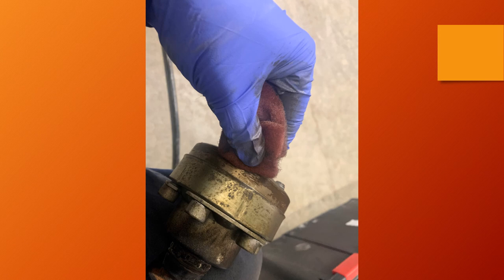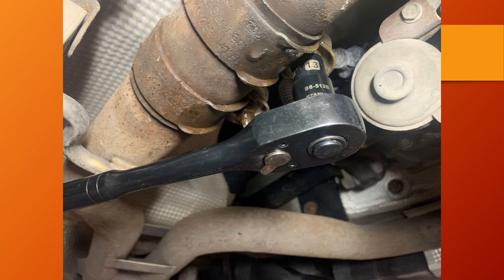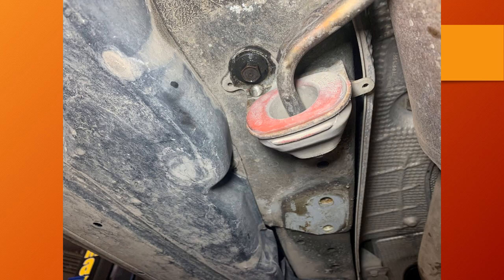I used a little bit of scotch brite to clean up the mating surface on both ends. Next, loosen the nuts on the exhaust pipe connecting clamp that holds the main catalytic converter to the exhaust pipe going to the muffler. Mine had never been removed and the nuts were really crusty, so I replaced those. Once the hardware is loosened or removed, slide the clamp towards the back of the car so the primary catalytic converter pipe is disengaged from the muffler section. There are also a couple of bolts holding a bracket from the main catalytic converter to the body that need to be removed.